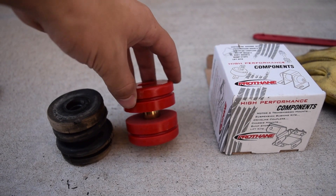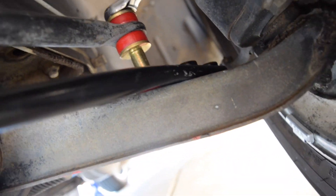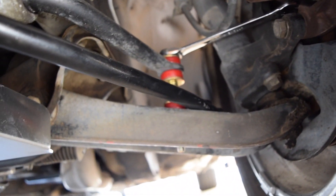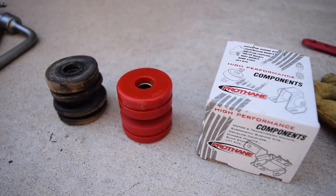Today we're doing these. Let me show you where the tension rod is. Under your car — hopefully it's a Z — you're going to have these things right here. There's a black bar that runs from there all the way up here, and that is our tension rod. What it does is it keeps the control arm from moving rearwards when you hit bumps, so it keeps your wheels going straight. We're going to replace these bushings, which were really worn out and cracked old rubber, with the new polyurethane ones.